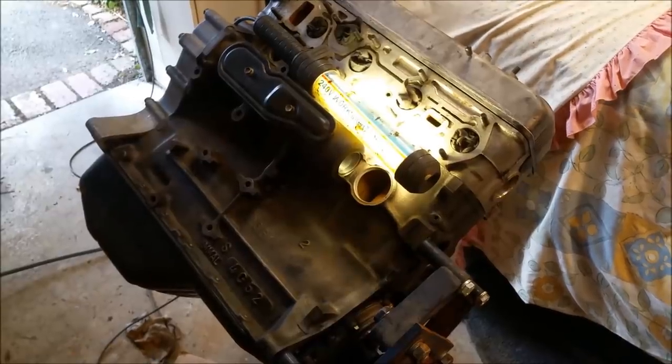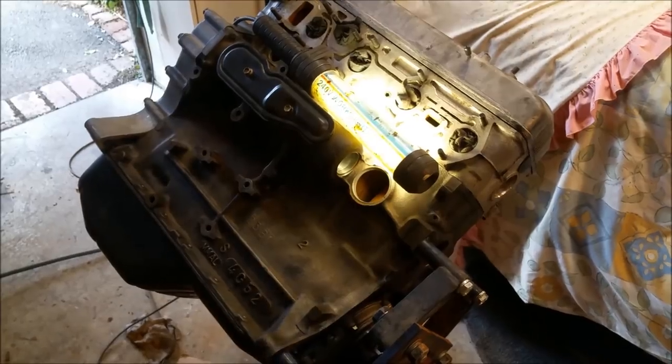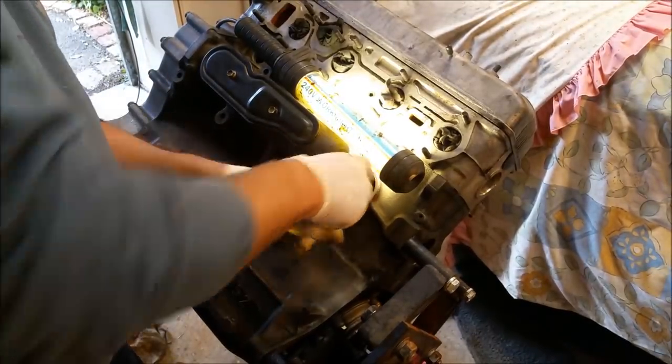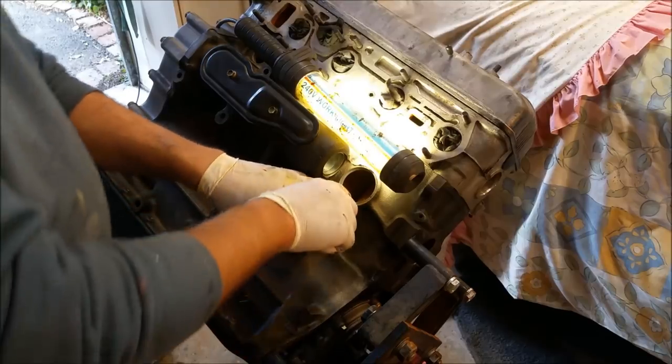Right, so I like to check the original plugs against the new ones. These brass ones are a little bit shallower than what the original mild steel ones were. If there's any doubt, here's the base of a vernier. I'm just going to use a screwdriver with my fingernail. Check the depth. We're spot on. So we can knock these in so they're flush with that inner ledge there.